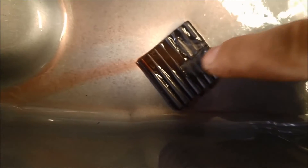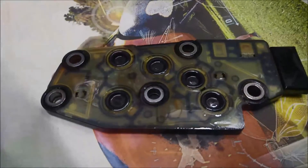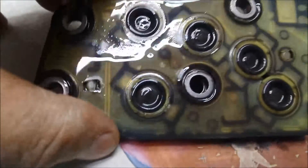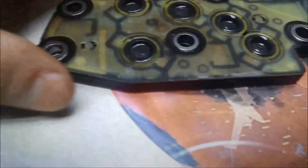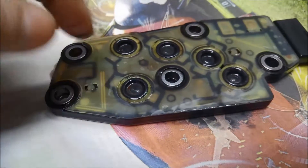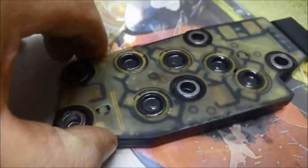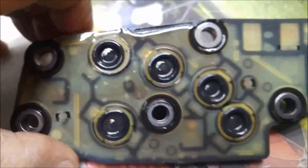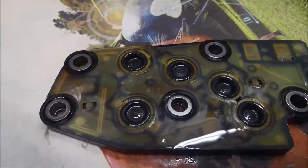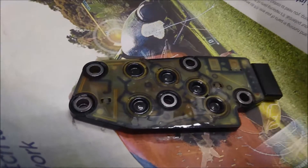The magnet has got a little bit of fine metal on it — you can see that's all fine metal. We've got that plate off, and quite often I've found that these don't register a fault code when they're shorting out or contaminated. They've got little pressure switches in there and you can see how much fine metal is in there. We're just going to flush that out. If it was doing it all the time we'd probably replace this, but since it was just an intermittent problem, if it cleans up all right we'll flush it and put it back in the vehicle.